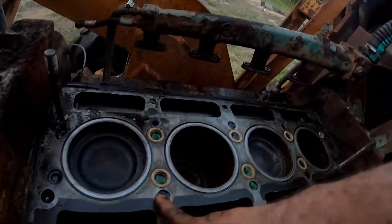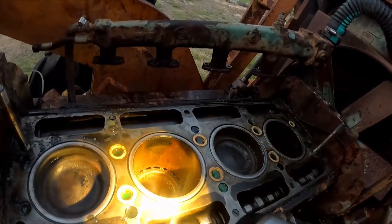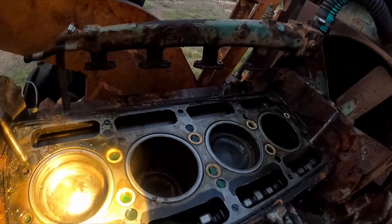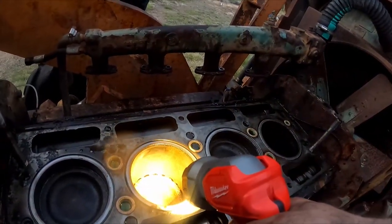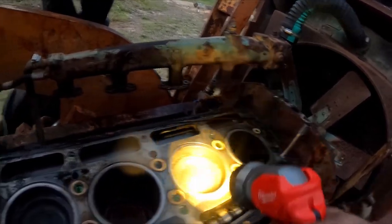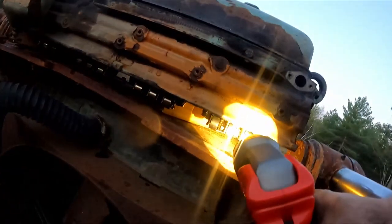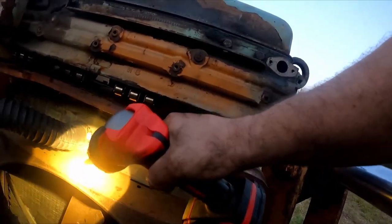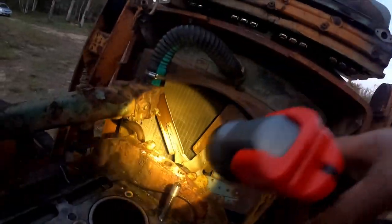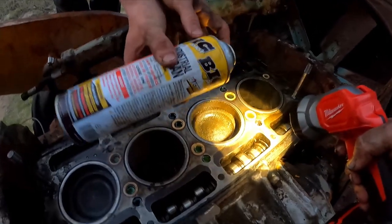I have to remember to bring a bar to put in that bolt hole to push on the tops of both of those cylinder liners, because I do not want them to pop out while we're messing with it - apparently that's game over, they don't go back in. I'm gonna hose this all down with PB Blaster, especially these cams. The cam rollers are in really good shape - they're not marred or damaged. Cleaning that up will let us get them in real easy.